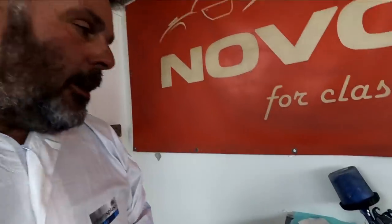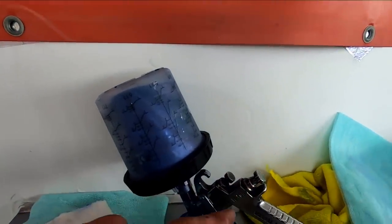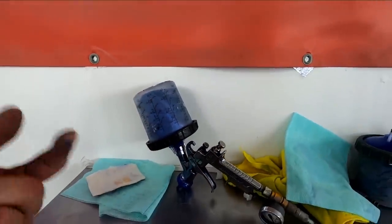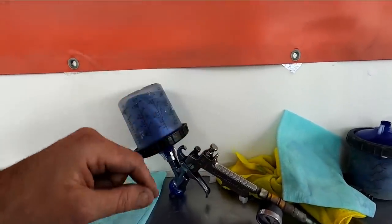So we've got all our base coat on. I'm ready to do the two drop coats. Now with the drop coats for our Wave 2.0 waterborne base coat, we actually have to reduce the amount of paint going on by 70%. So we've actually got a gun setup chart for the particular gun that you use for this product. Because every gun has got a slightly different pitch to the thread on the paint control. So the setup chart tells you exactly where to set your gun to get just 30% material.